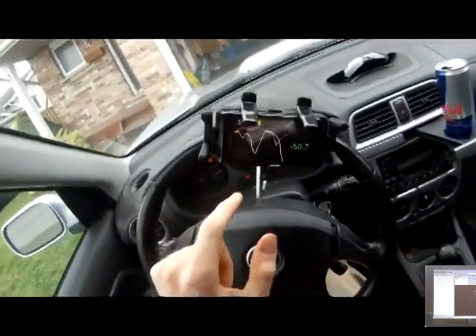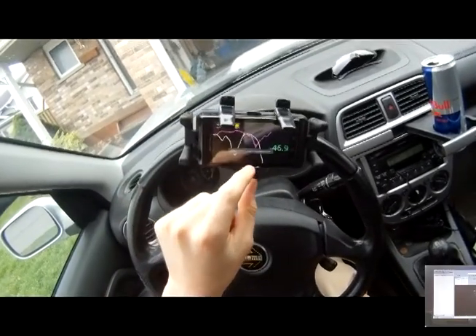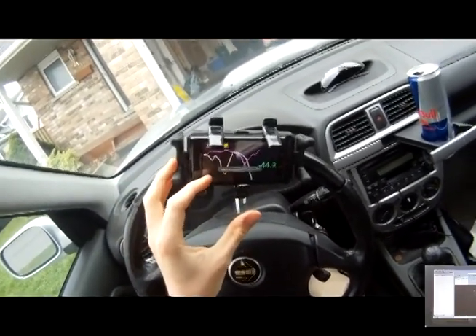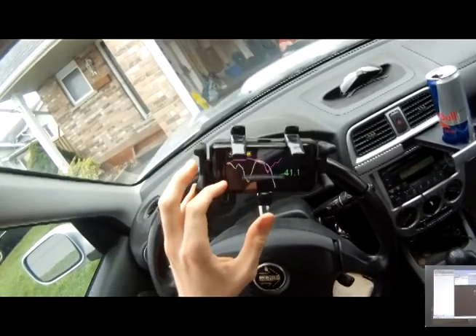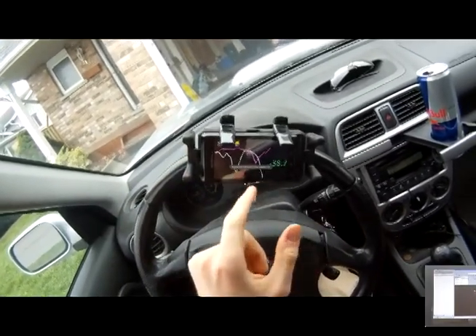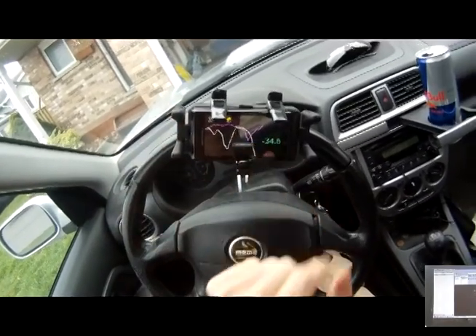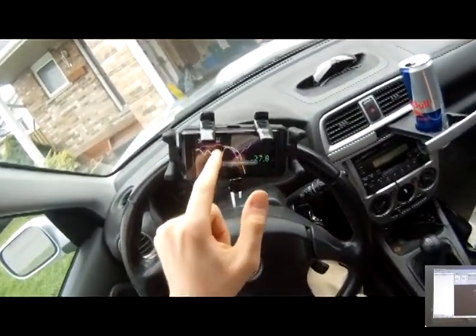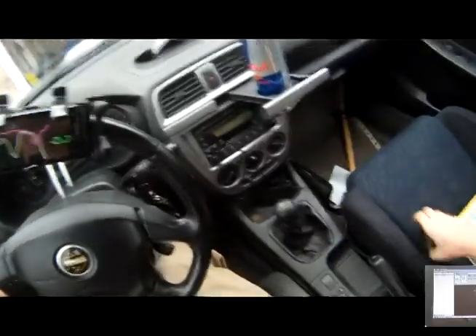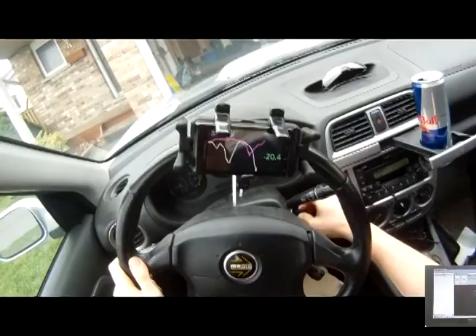You can actually look at the status icons by tapping on them and it'll tell you what's up. Here it's saying it's trying to connect to the router but for some reason failing. Here it says we're reading the OBD2 device at 3.6Hz, and if I look at the GPS it says it's working at 10Hz. That's a good way to figure out if things are working and if not, it can help you figure out why. In this case the router has just reconnected and has probably just transmitted my last lap.